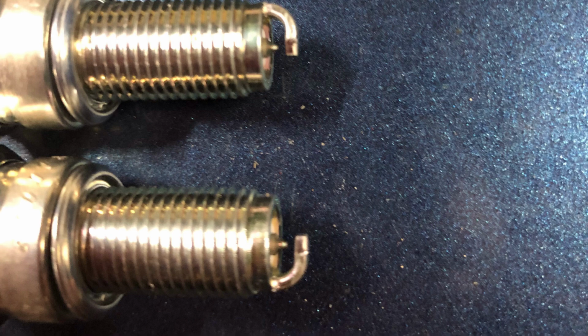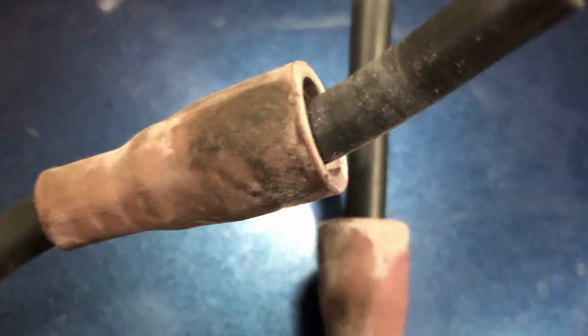but they will very soon. This next photo shows the truly awful HT leads, standard HT leads, off my bike, with what look like those cover things. Look like they're made out of red plasticine, don't they? I mean, they're truly awful, dreadful things. And the HT leads on my bike were absolutely rock solid. They are copper cord, PVC outer. They're absolutely rock solid, frozen in position.